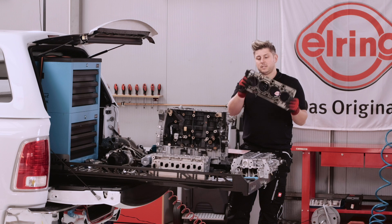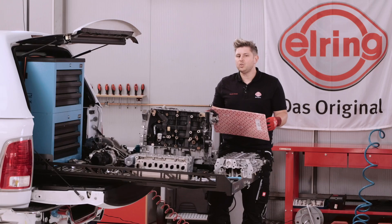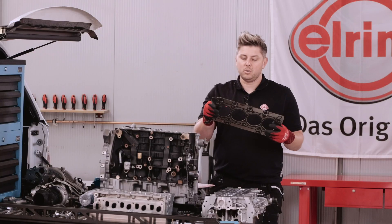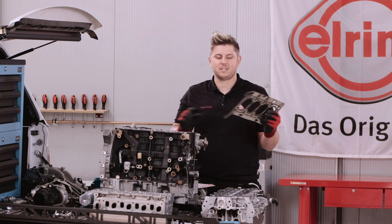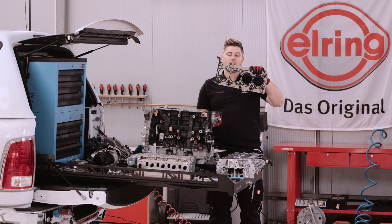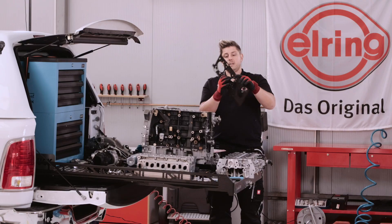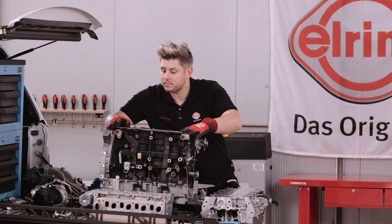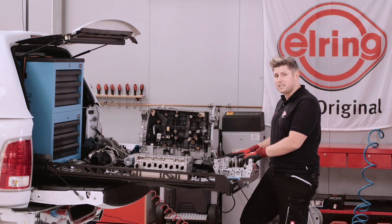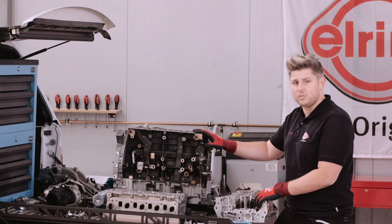The next step is to replace the old cylinder head gasket with a new one. Very importantly, do not use any kind of liquids because this gasket is ready to mount. You don't have to use copper spray or anything else — this is not necessary. Ready to use out of the package. Check that you mount the cylinder head gasket in the right position, as you will find the marking 'TOP' on the gasket. Place it so you can read it on the engine block. Next, mount the cylinder head back to the engine block, but be careful with sharp edges so you do not destroy your new cylinder head gasket.